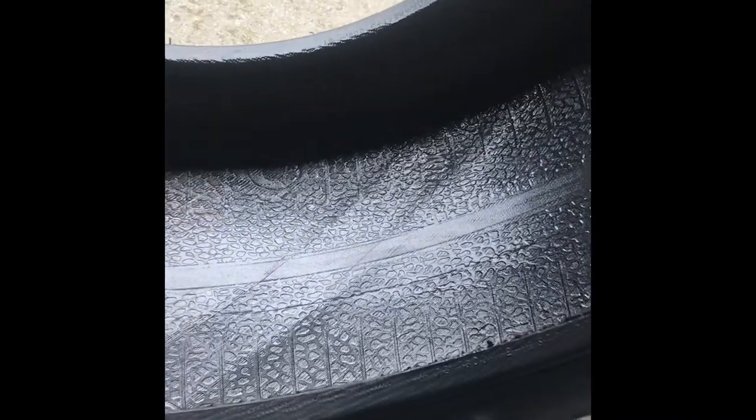We're rubbing dish soap on the inside of the slicks and letting them dry. It's an old-school trick — not totally sure on it, but it keeps them from leaking down so bad. These softball slicks, if you just air them up, they'll leak down within about a week or two. Apparently the soap dries into a waxy film that seals it and prevents it from leaking down so bad. We're gonna let them sit for about two or three days until they wax up, then mount them.